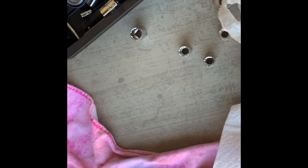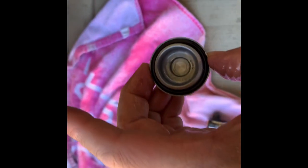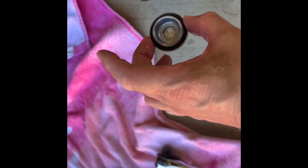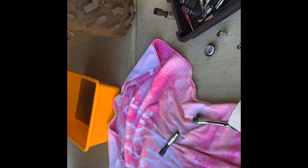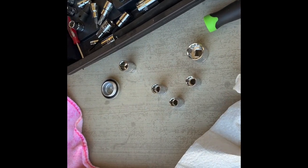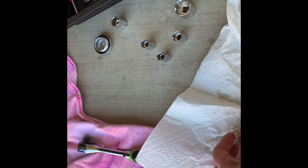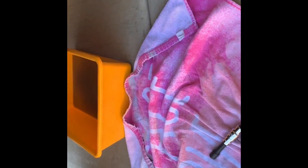You don't want to put them back on and torque them too hard. This front fill bolt feels so light — I could probably drop it. You don't want to step on it and ruin it. So we've got the oil drained. I'm going to let it drip for a second and then put the plug back in — just hand tight. The manual does have torque specifications, but just take it easy when tightening stuff back up.